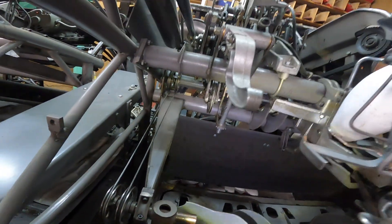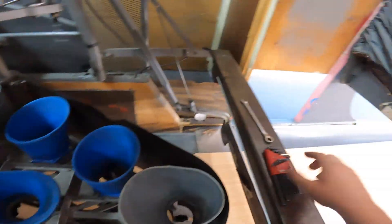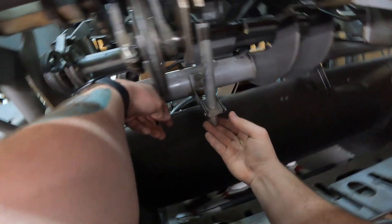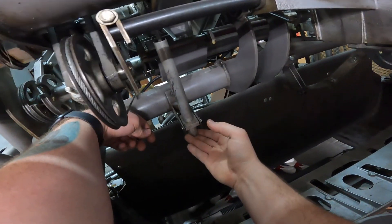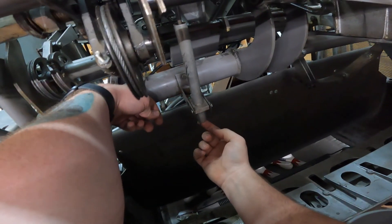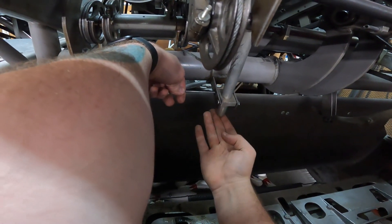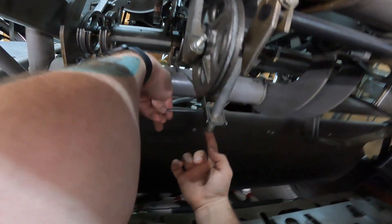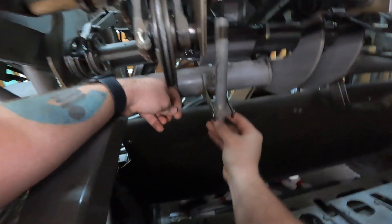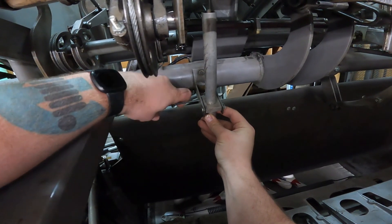Now that the jam nut is tight, what we have to do is loosen the allen head screw on the stop collar. With the second half of the adjustment, what we will do is push up completely on the tube — not compressing the spring that is inside. A good way to do this is to push on the bottom of the rod, not the bottom of the tube, so that it does not move more than it should. As it is completely up, we're going to drop it an eighth of an inch and tighten the stop collar from there.